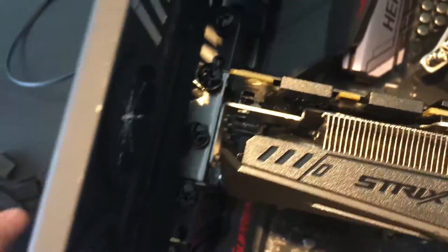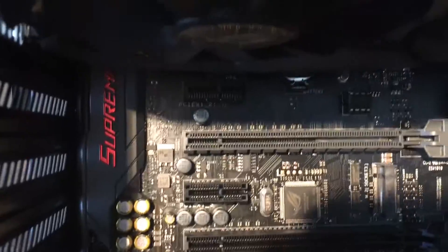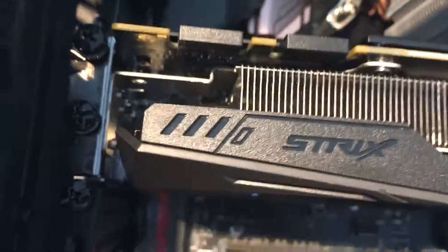So that's basically it. Just with this case, those screws — it was kind of a tight fit, so just be wary about that. All you do is make sure you open this little knob here — make sure that's open before you actually insert your graphics card. And then once it's in, just try to slide it back in with your finger. You can also install it on the gray PCI slot — it wouldn't make much of a difference. I also kept the SLI bridge things still inside. Now this GPU also comes with two fan headers, but I don't think I'll ever be using them — these aren't even PWM fans, so it wouldn't be much of a use.